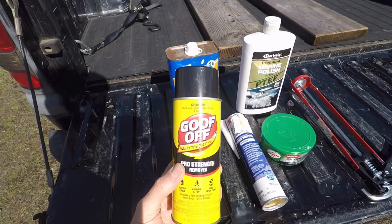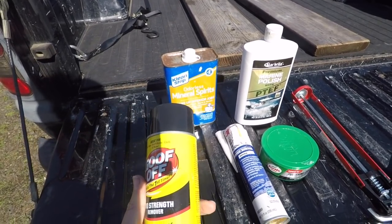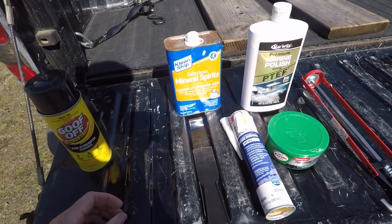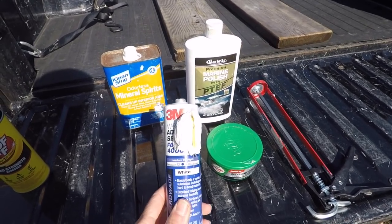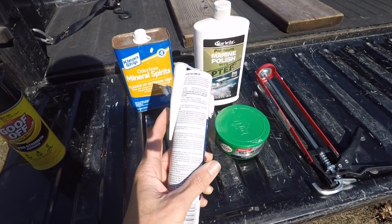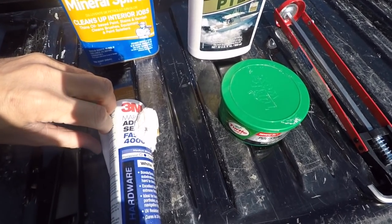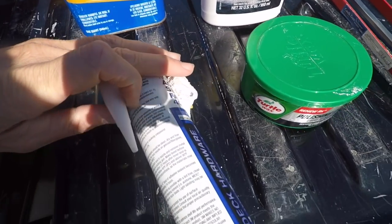I just wanted to show you a few of the products I use to maintain the outside of the camper. The first one is Goof Off — I use this to remove any kind of decals or adhesive. It works awesome; just be careful not to use too much and read the instructions. Second is mineral spirits — this is the go-to cleaner for everything, really good to have when you're caulking. As far as caulk goes, my favorite is 3M UV4000. It's not permanent and can be removed. It has a thread-on removable caulk tip. When it dries, it's very tacky — it doesn't flake off or rub off. Really, really good quality stuff. I highly recommend it.